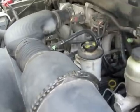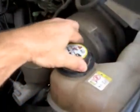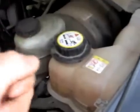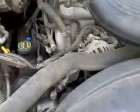If you answered yes, I have to add antifreeze, I'd want to hook up a cooling system pressure tester. I'd take this cap off and hook on what's almost like a bicycle tire inflator, and pump air into the system with this little handheld pump. The air would fill up the rest of the radiator and the hoses — the radiator hose, heater hoses back there, and all the gaskets and O-rings that can leak. Once I've applied pressure to the system, it'll pinpoint where the leak is.